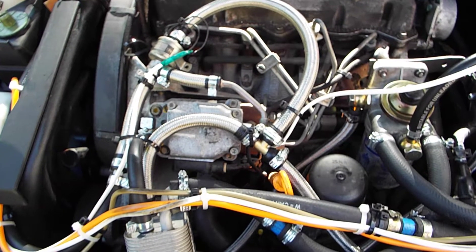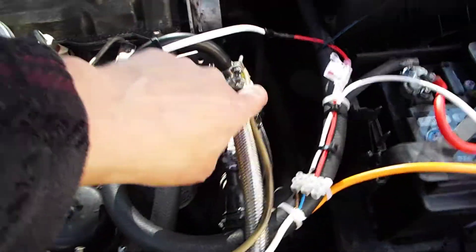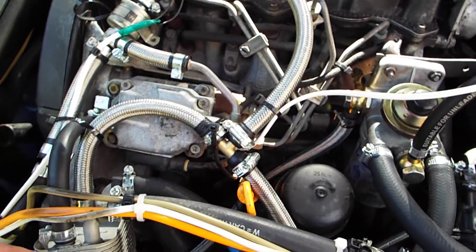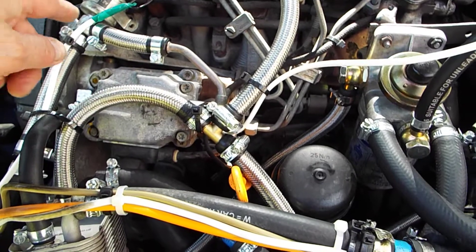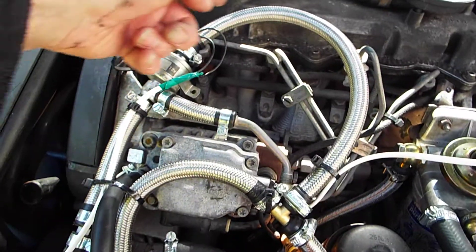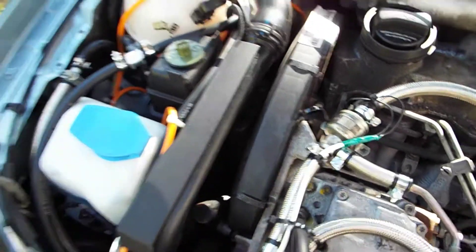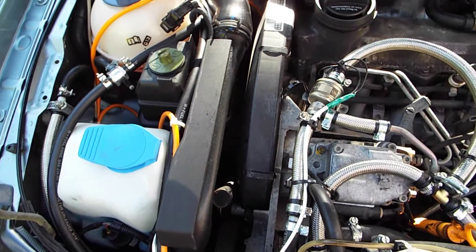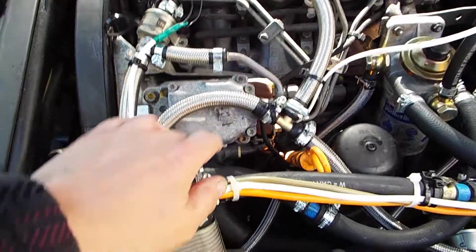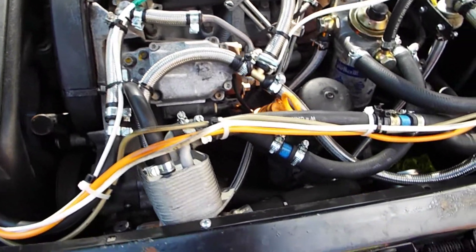Once we're ready to purge and switch off for the night, or we're cooling down, we switch to purge, which opens this valve here, switching off the fuel select, which defaults back to diesel. So diesel now comes into the system, through the heat exchanger, round the loop — and instead of going back into the loop, the output will be fed through here and back through this pipe to the tank in the boot. I can purge for 10-15-20 seconds — it doesn't matter how long — because I'm just going back to the same diesel tank. So whatever vegetable oil is in this little loop will go to the diesel tank, which doesn't make much difference at all. And that's basically it.